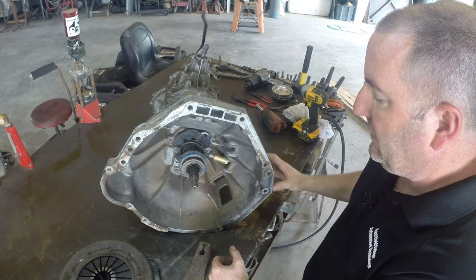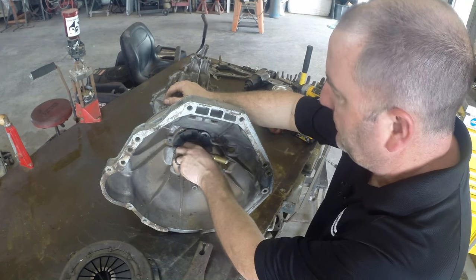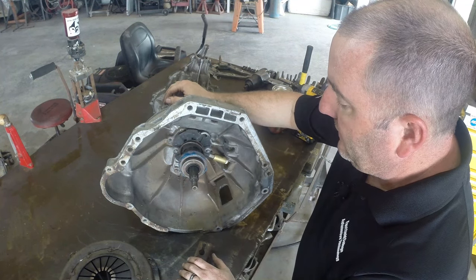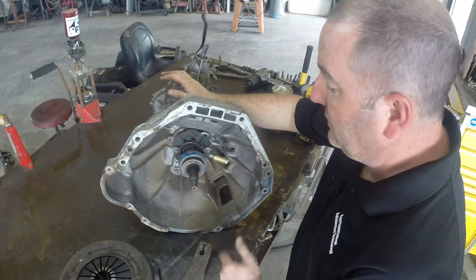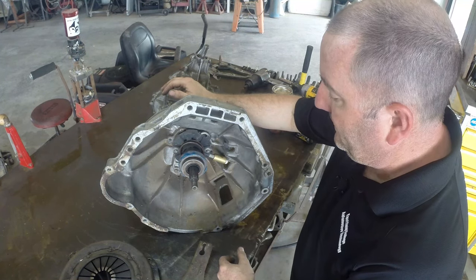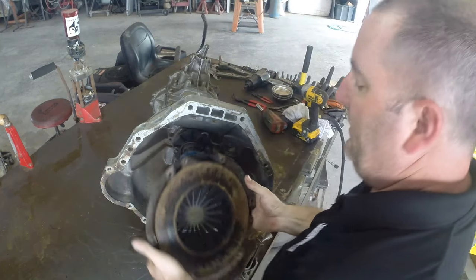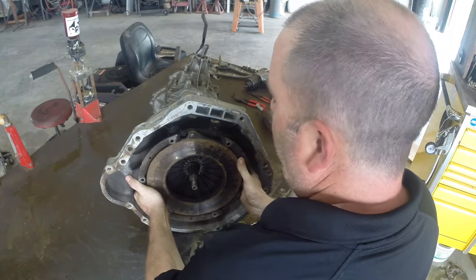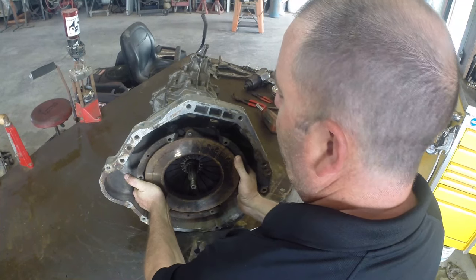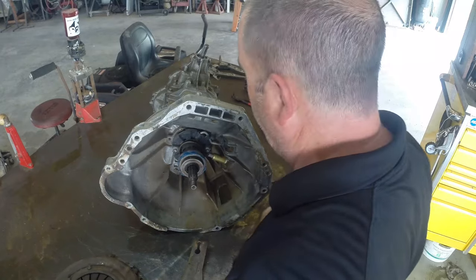It's no longer a bolt-on to the side — just two bolts and a line to replace the slave cylinder. You've got to pull the whole transmission out. The next side of that is if you're going to do a clutch on one, you might as well do this while you're in there because it's not going to get any easier. The pressure plate lives here and the slave just pushes on the forks of the pressure plate.